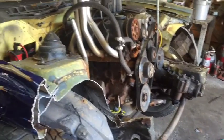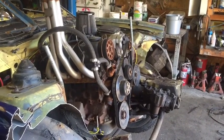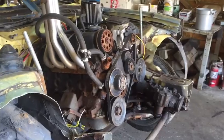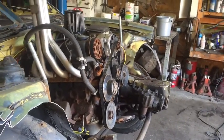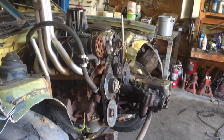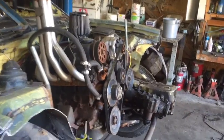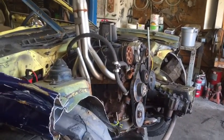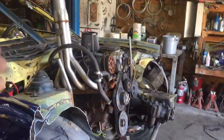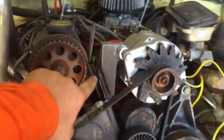We're going to throw a battery into it and all that fun stuff and see if we can get it to go and see if it's still having the same problems as it did last year. If you watch the video, near the end of my run in, I think it was mini heat number 6 or 7 at Fall Brawl, it was running great. It had power. I was making good hits, and then all of a sudden everything went to crap. The motor started shaking very badly. It was puffing out a lot of black smoke. I don't know if something went wrong with the carburetor where it was giving it too much fuel, or if it jumped a tooth on the timing belt, because the timing belt is quite loose.